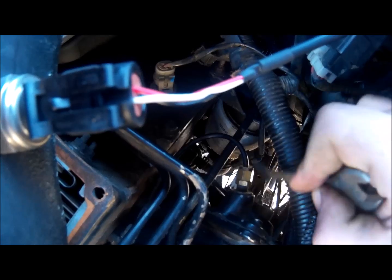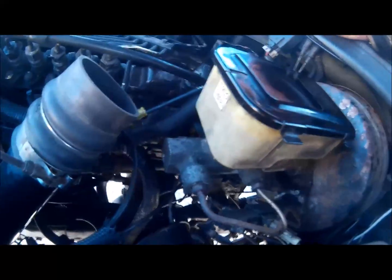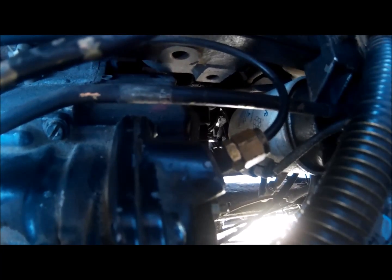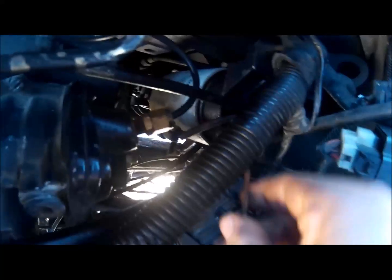You're just going to loosen up the lock nut — righty tighty, lefty loosey. Now your lock nut's loose. If you're looking to have no power and no smoke, you're going to put it all the way back in towards the truck — righty tighty. If you're looking to tune it up and get a lot of smoke, you're going to go out towards the cab. For a lot of smoke with power only at high RPMs and rolling coal, take it all the way out towards the cab using a 3-millimeter allen wrench. For this video, I'm only going to go out about a turn and a half to two turns just to bump my throttle up.